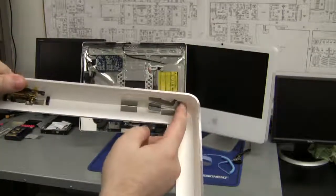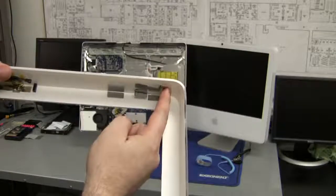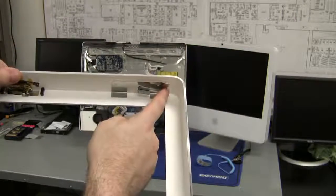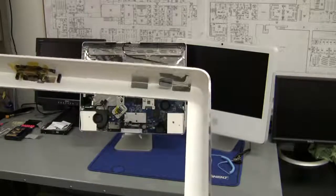What's happening is on the inside of the iMac there's a little plastic post and these grip onto that. When you're pulling from just the bottom, you're going to break these. If you break these, you're going to have a loose panel on your computer.